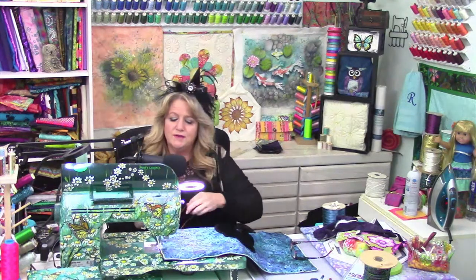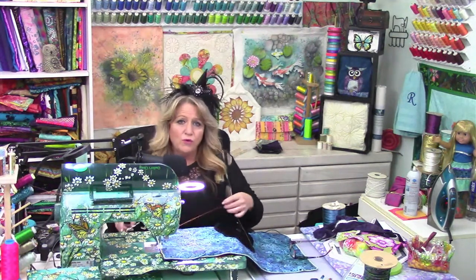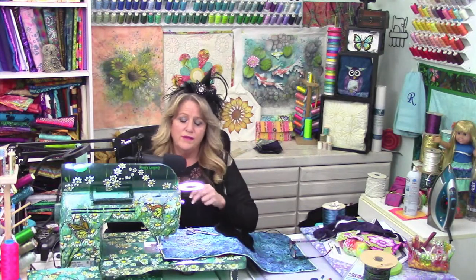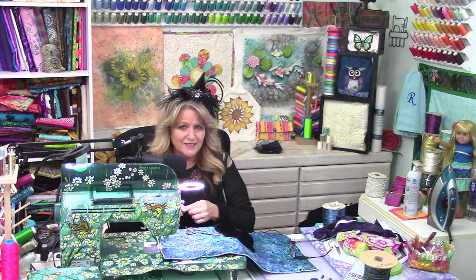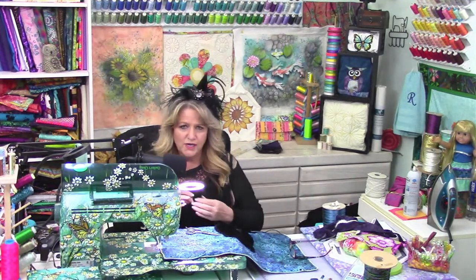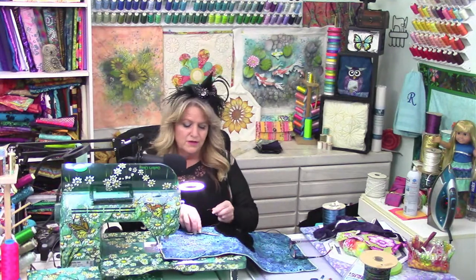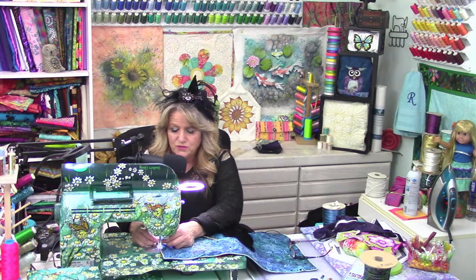And the reason I say a sewing machine mechanic is because there's actually a pad that's hidden inside of a part that you would not be able to see. And if you don't replenish the oil and have a mechanic look at it, sometimes the oil can become rancid and get sticky and make your machine start malfunctioning in weird ways. And you're not really aware that that's what's causing it. So sometimes you just need to take it into the doctor and have its checkup.